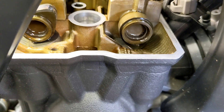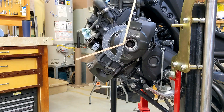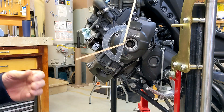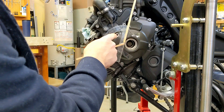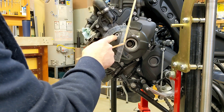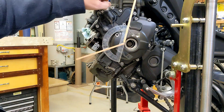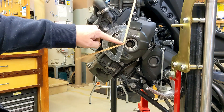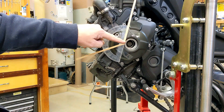I'm trying to find the 125 degrees before top dead center, so I'm doing a little reality check. I have this set at the 125 degrees before top dead center mark. I set up a protractor — 90 degrees there — and made little indicators at 125 degrees.